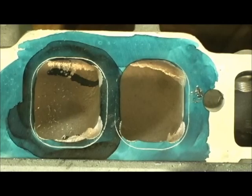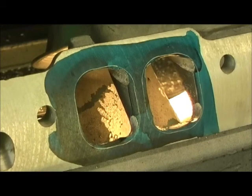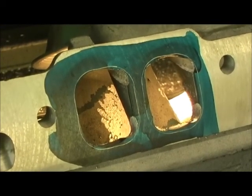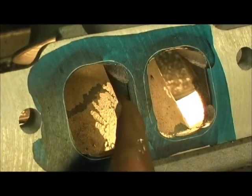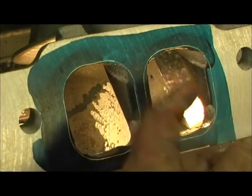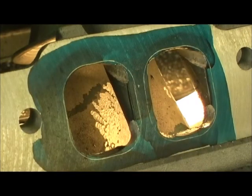Let me give you some shots from another angle. Right here near the back two ports — distributor hole side — this would be cylinders six and eight. Look at the dramatic turn they're doing there. I'll probably take a quarter inch starting from here, pull that whole thing in the same way, and at least a quarter on the bottom. So a quarter going this way for the shift, and a quarter going down. Roofs pretty much line up — this is going to make just a tremendous difference.